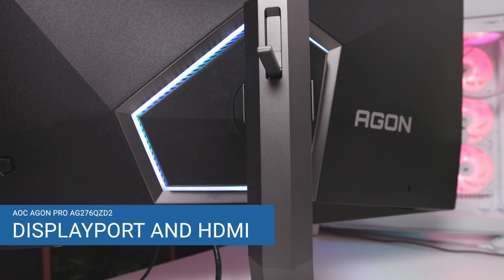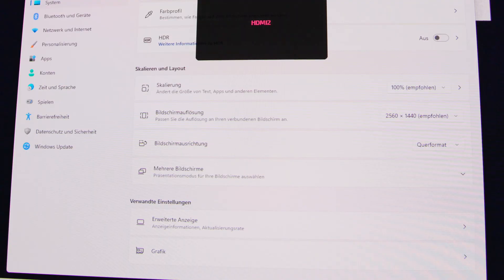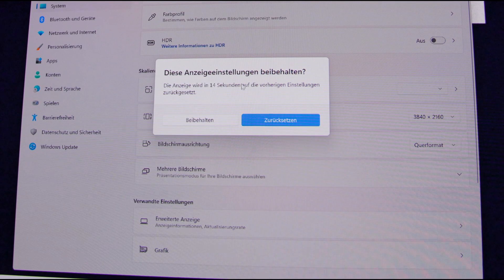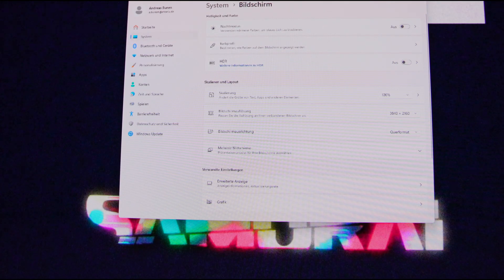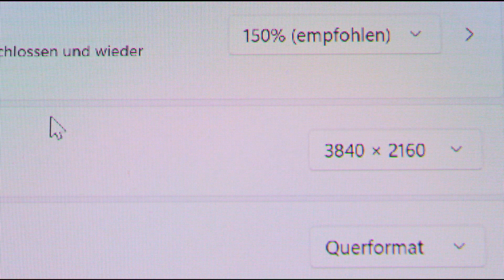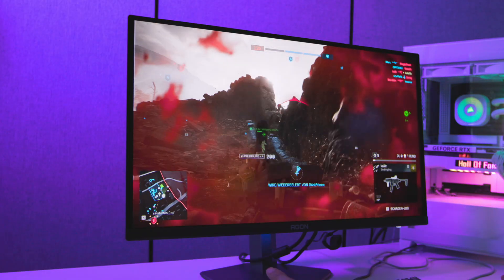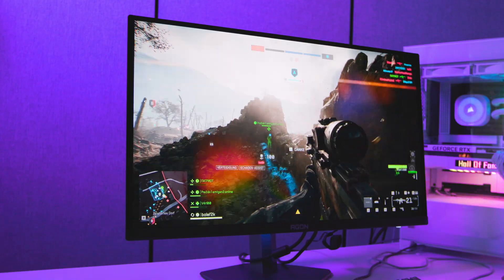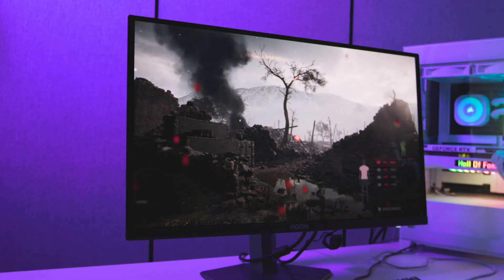During testing, we noticed unexpected behavior from the monitor. Connecting via HDMI cable results in a blurred image, and the resolution can suddenly be set to UHD 4K in the settings, although it is not actually supported according to the specification. AOC informed us that this is intentional — this resolution is only achieved at 60Hz, targeting console gamers who play at maximum 60Hz in UHD. When connected via DisplayPort, the image is significantly sharper, even if pixels per inch are not outstanding compared to 4K or 5K displays — though this is hardly noticeable when gaming. Via DisplayPort, you can select refresh rates from 60 up to 240Hz with no problems or dropouts. Nevertheless, a slight discomfort remains, as a high-end device in this price range should ideally deliver full performance on every port without restrictions.